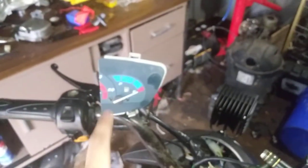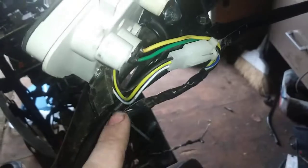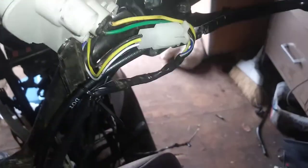I got a rebuild kit coming in and an exhaust. Finally got the pod setup done. Usually when people do this strip, they lose their fuel gauge — I kind of need my fuel gauge — so I cut out all the lights and wiring except for the few wires that go to the fuel gauge and the one light so I can see it at night.